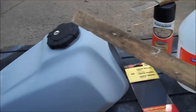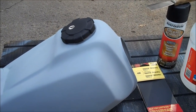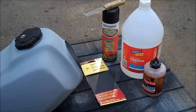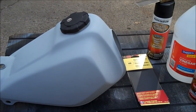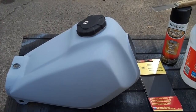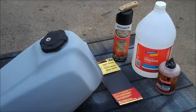Fill the tank with all the vinegar you need to top it off, then throw in some BBs. You need to leave it for at least a week. During that time, shake it up once or twice a day. I like to level the tank off with vinegar and BBs in there, wrap it in a couple of plastic bags, and then shake it up at different times of the day for about a week.